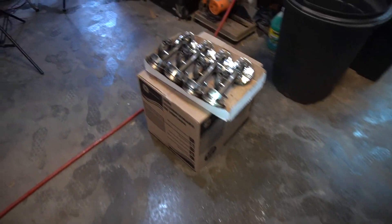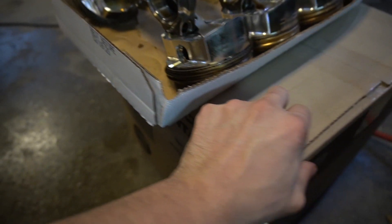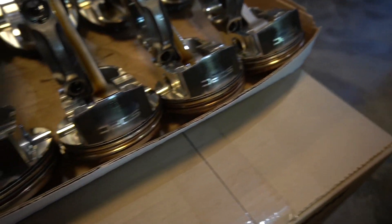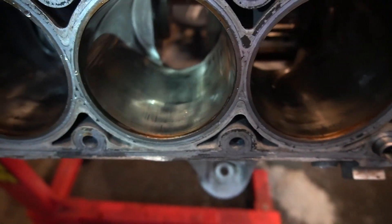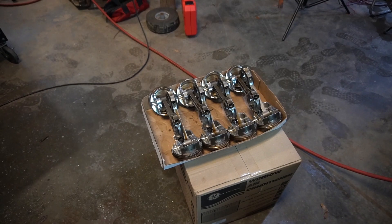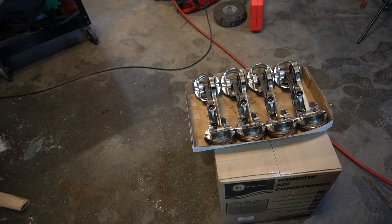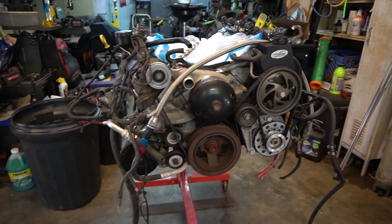Got the pistons out — they're forged pistons, so they'll have a little more rock in the cylinders than usual. The black coating is a little worn off on one or two of them. I'm going to go back in and do a little light honing — I don't feel any ridges when I put my finger in there. The crank is looking good and you can see where they machined it for piston clearance. I'm doing the ring gaps and I've got my ring gap tool coming in the mail to hand-grind them to the right specs for running a turbo. My next video will cover clearances and everything.